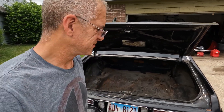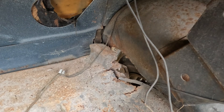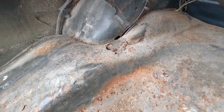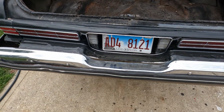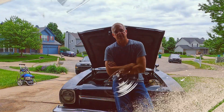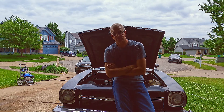Let's have a look at the junk in the trunk. That shock mount I was talking about earlier would have gone right about here. This is the other side — it's not great, but at least it still has a plate in there. There's a hole there, there's a crack there. The rest of it's not so bad. I'm just worried about this back bumper. It is a rusty mess under there. I think I can patch it back together and make it. The car ran okay. On the way up here — a one-hour trip — I did have two incidents.